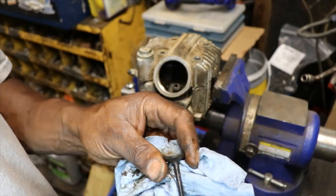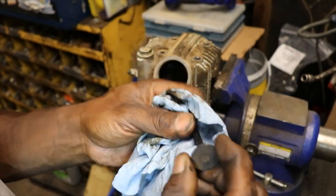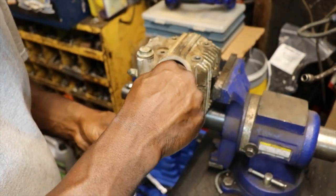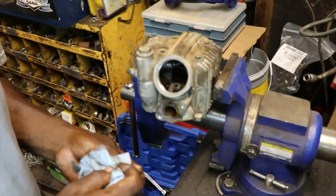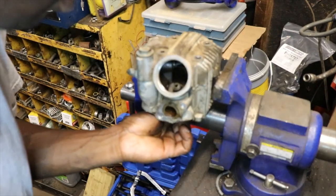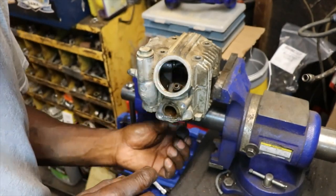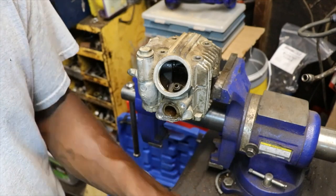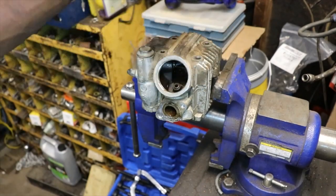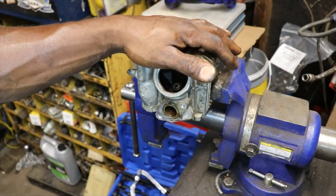It didn't bend it. Got some pitting on it. Valve stem seals, I mean, need to be changed. Yeah, I'm gonna have to clean that. So this thing's gonna need rocker arms, valve stems, valve stem seals, and a whole top end. Ring, piston, cylinders, gaskets,